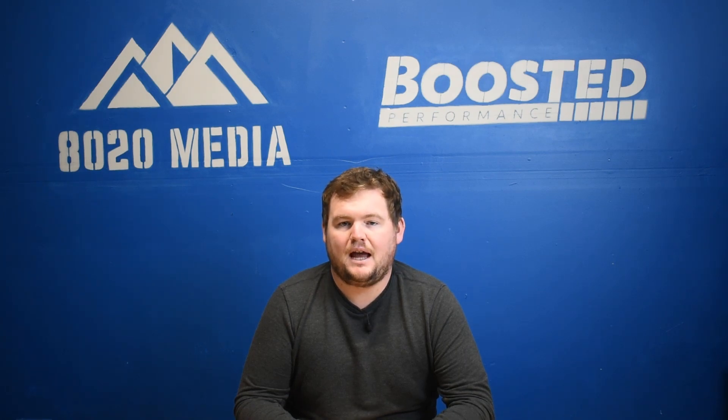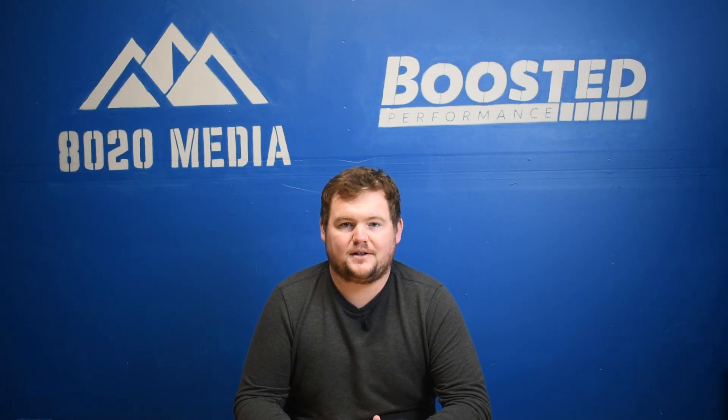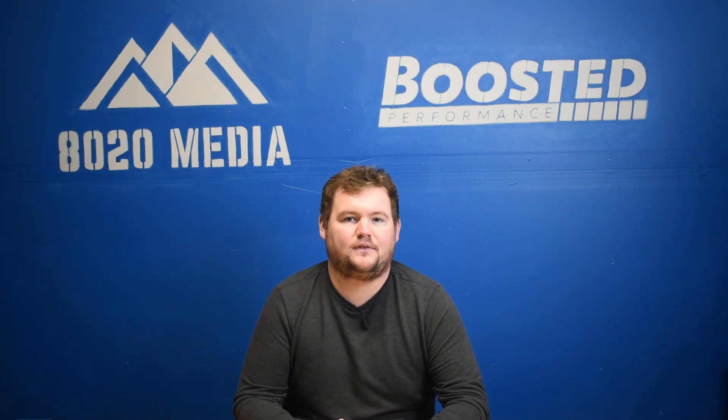Looking at the N55 specifically, it was a successor to the N54. The N55 was designed in 2010 and was primarily produced from 2010 until 2015, when it was phased out by the BMW B58 — the newest iteration of the 3-liter turbocharged engine family. One side note: the N55 was around a little bit longer; it was in the BMW M2 for a couple years until BMW decided to put their S55 engine into the M2. We're looking at the basic N55 here, not the M2 version, as there were a number of changes to support the M2's focus on track performance.